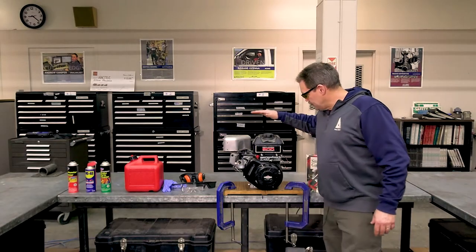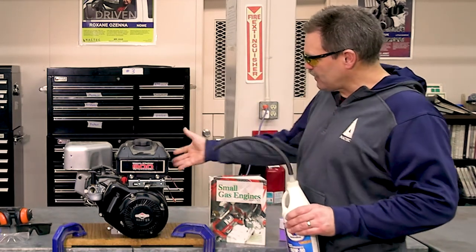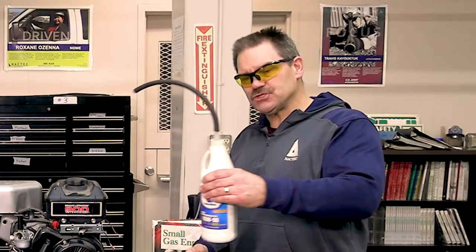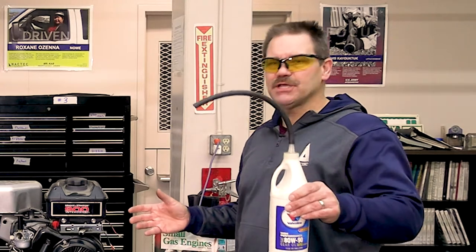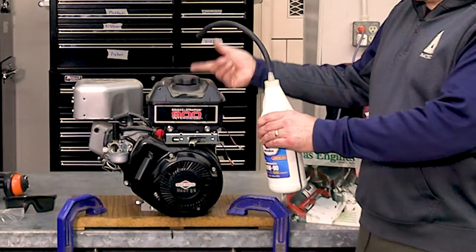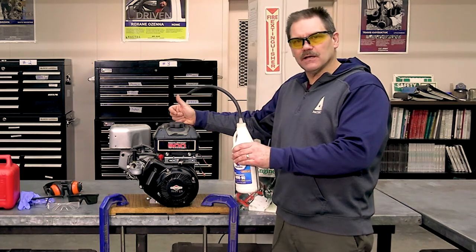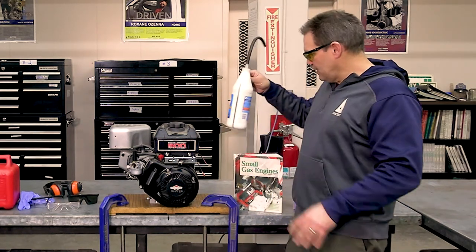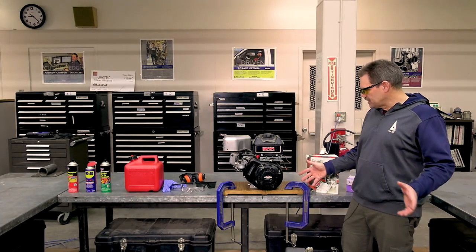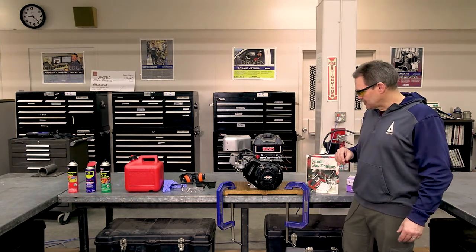Next, we're going to talk about safety with the engine. One of the best ways to get the gas out of this engine, rather than having to take the gas tank off, is to take the gas cap off. Take a jug that usually has gear oil in it, put a hose on it, squeeze it, stick it down in and let it go — and it will siphon the gas out of the gas tank. It works really slick and it's really safe. You can dump it in the gas can and make sure it's properly stored. Also drain the oil, because if you leave the oil in, it never fails that the gasket doesn't quite seal and it makes a great big mess.